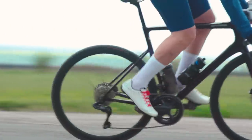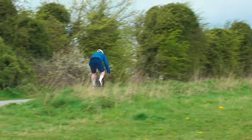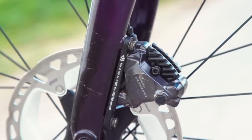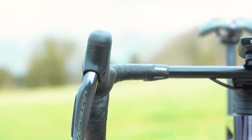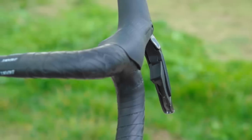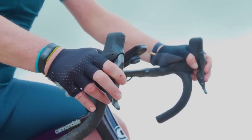The braking performance of Shimano's 12-speed road groupset presents a considerable upgrade on the already excellent 11-speed version. The redesigned calipers allow for more clearance between rotor and pads, meaning the scrapes and rub I could induce on the previous version have been completely eliminated. The new lever shape combined with the introduction of ServoWave — brought over from GRX and the brand's mountain bike groupset — has made the braking feel simply stunning. ServoWave sees the braking ramp up power in a smoother curve, so you get a much more progressive sense of brake power increasing, making it easier to avoid scrubbing too much speed at the initial part of the lever stroke.